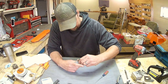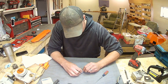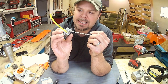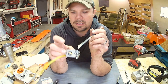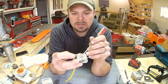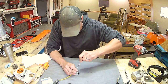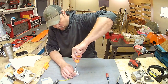This looks very clean, so I'm not going to go too deep into it. We're not going to take out — there's the screen — it's like the last line of defense. It gets past the filter and picks up the screen so it doesn't come in and cause problems with the needle and the seat that's down in there. We'll take that out just to look at it and I'll get a chance to explain how that works.